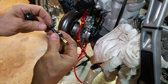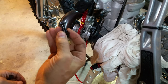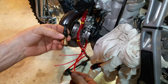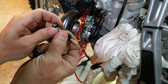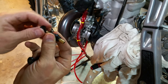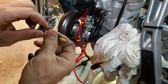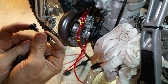If you can barely touch the thing and it falls back down, simply put, this piece is worn out. I have a brand new one here and you'll notice it's a much more solid click when you pull it up — you have to really push on it to release it from the choke position.